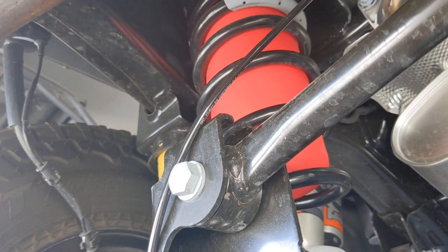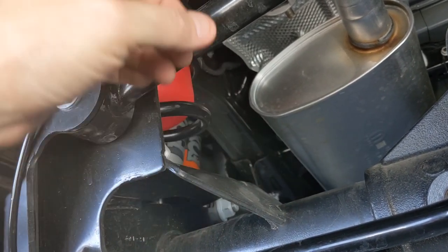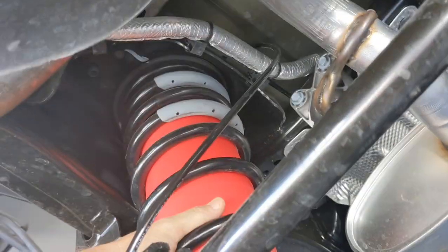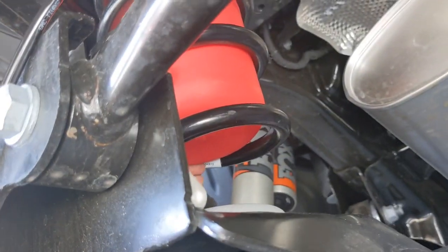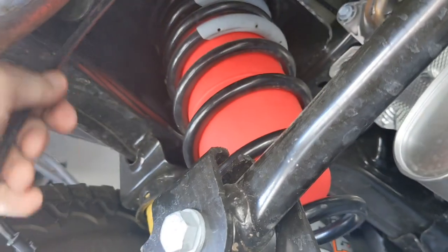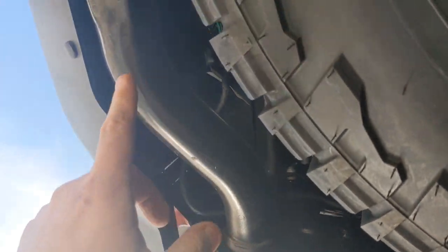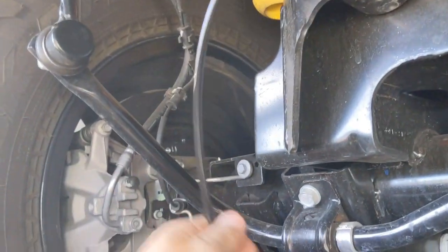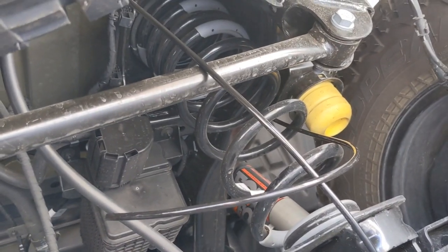You can see all the space in there — that's why it doesn't affect your ride or your articulation. At full compression the air just pushes out, and at full droop you still have room; it's not hindering the suspension at all. At full droop the coil springs tighten up a little but the bag still has some play. You can pull the bag down and out, it slides right back up, and the puck sits on top. We'll leave a little slack in the hose, run it on the other side of the frame away from the exhaust, and I may need more airline — we'll see once the second bag is in.